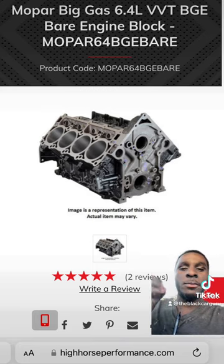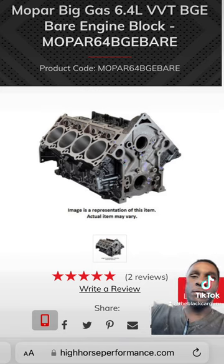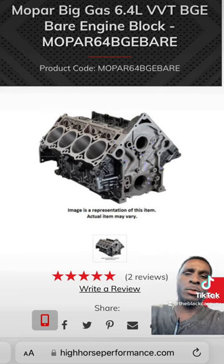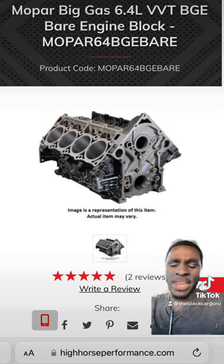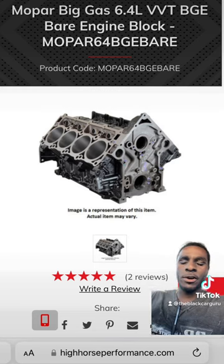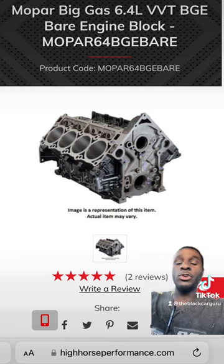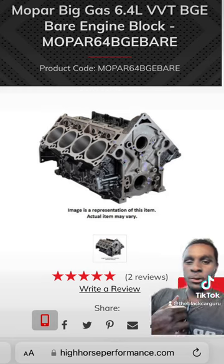This definitely needs to be the basis of all your builds. Even if you don't buy one from High Horse Performance, you can always go to a junkyard, find a wrecked truck with the 6.4 Hemi in it, snatch all the internals out, go back with forged internals, ARP head studs, a better oil pump, port those heads, use the car 6.4 liter Hemi intake manifold, and throw some boost at it.